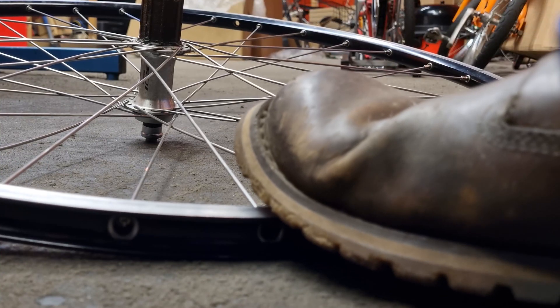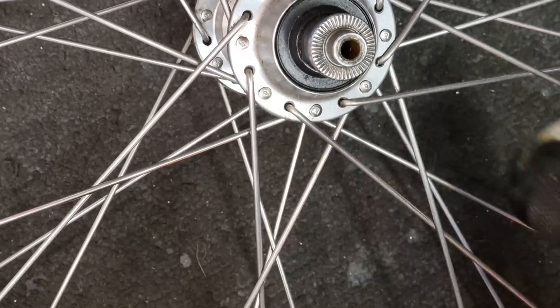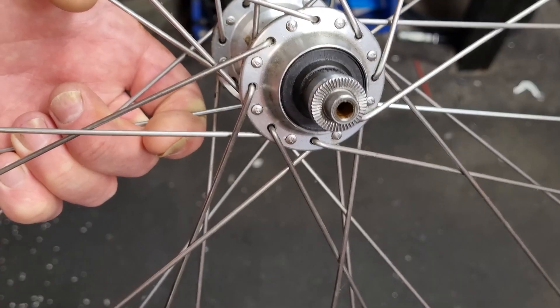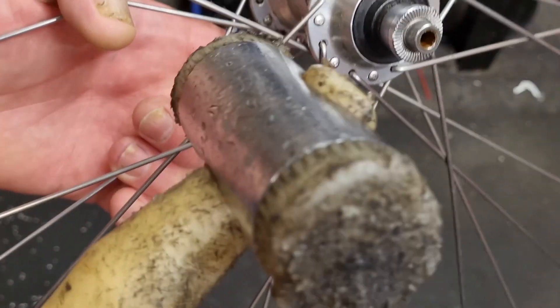If you've forgotten to bed your spokes in, not all is lost. The safest way is the method I showed — doing it while the spokes are loose before you take any tension up. But if you forget, you can do it with a mallet, which is the way I used to do it when I first started building wheels. It's a little bit dangerous, but if the wheel is already tensioned it's really the only way to do it properly. Put the wheel on the floor, stand on it with one foot on the rim, feed the handle through and push the inboard spokes down with the end of the mallet. On the outboard spokes, just tap them in until they go flat. Be careful not to push too hard and don't hit them too hard on the outboard ones either.